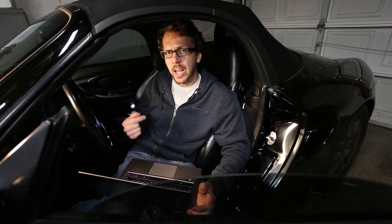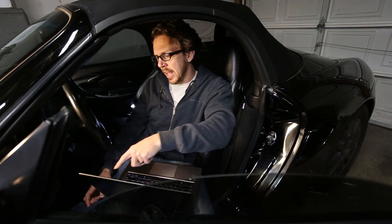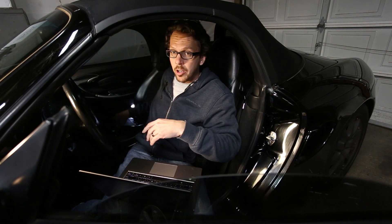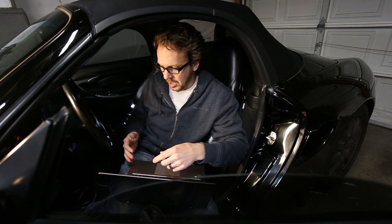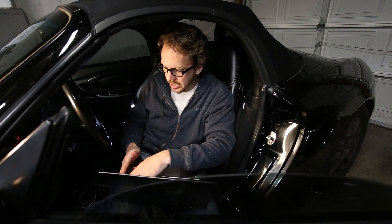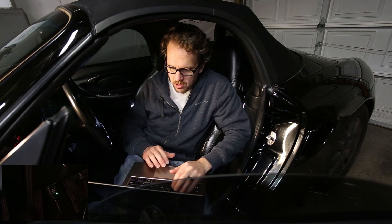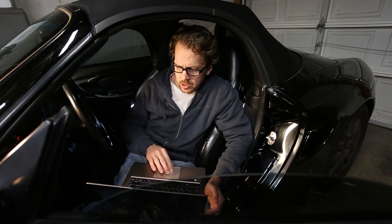Let's go ahead and hook it up. It's pretty simple. You just plug it down into the OBD2 port and then connect it to your laptop. Turn the car ignition to the on position or the start position. With the car running, or the ignition in the on position, and the cable connected to the USB port on a PC, a little green light should show up. That's when you know you're ready to go, and you just launch the Durametric software. It only works with a cable from Durametric — there are a couple of cheap Chinese knockoffs. They don't work. Don't bother with them.